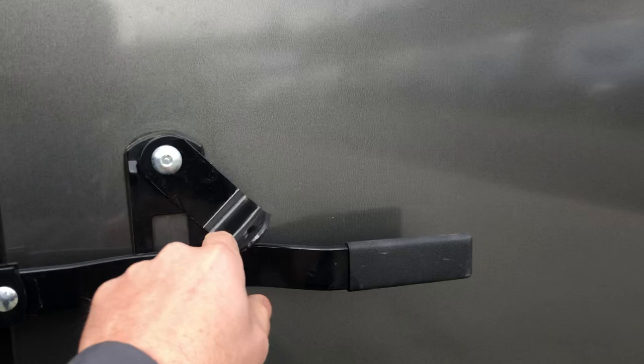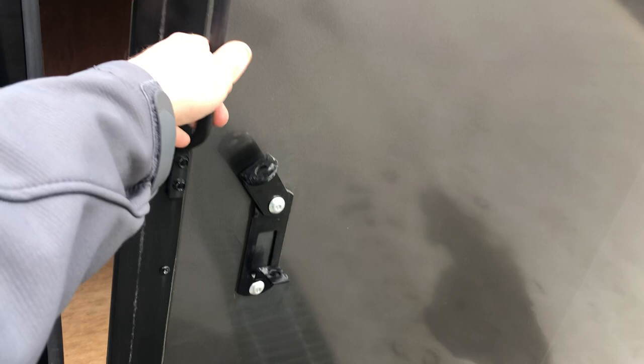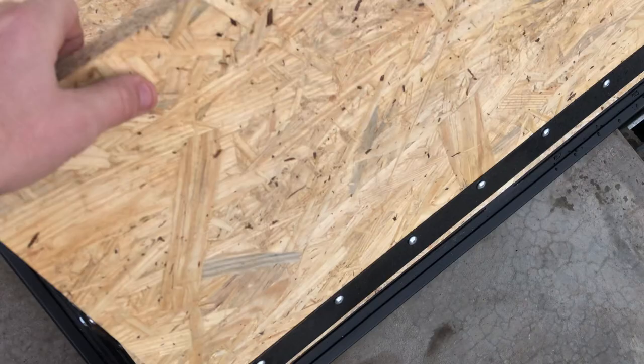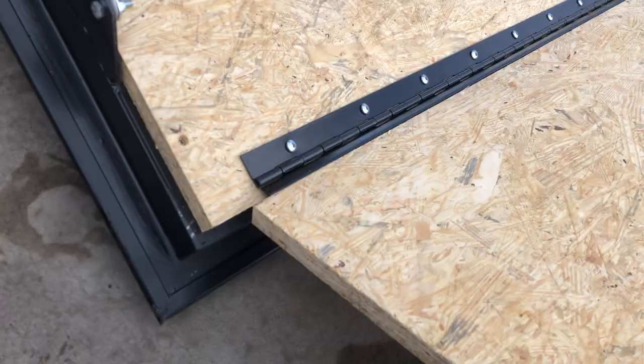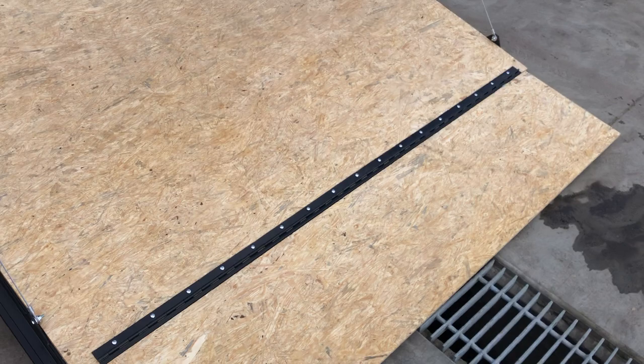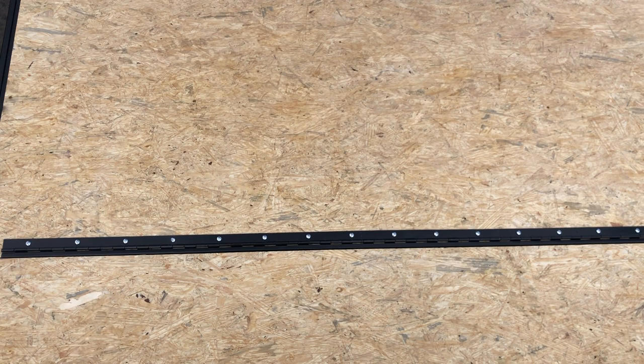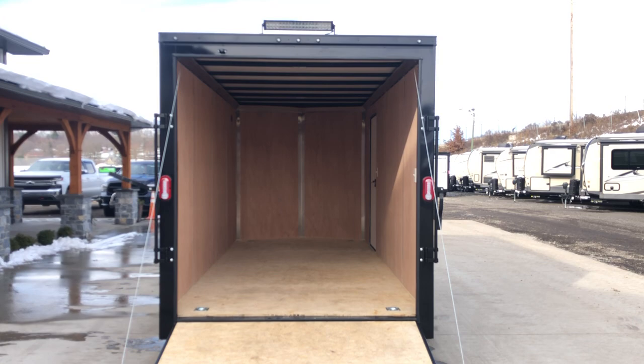Another little detail: ShoreTrak uses a little bit nicer, bigger hardware than what you would normally see. This is also a Z-hinge on the ramp flap extension. A lot of them will use a traditional butterfly hinge that goes topside on both — this actually Z's underneath, making it a little bit more durable. You also notice on that ramp flap threshold transition there are more tappers than normal. We see a lot of them do about an eight or nine inch screw pattern — these here are on about a four inch. Important for your commercial guys or anybody in landscape or similar, because a lot of times depending on the screw pattern they'll tear those off within the first year or two.